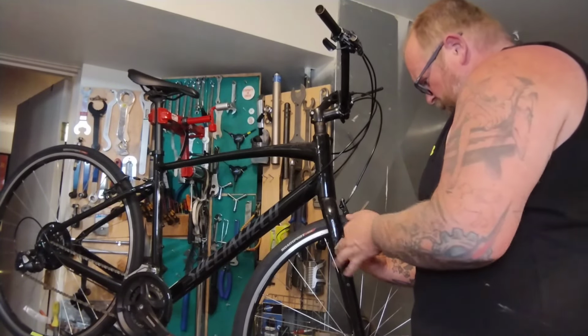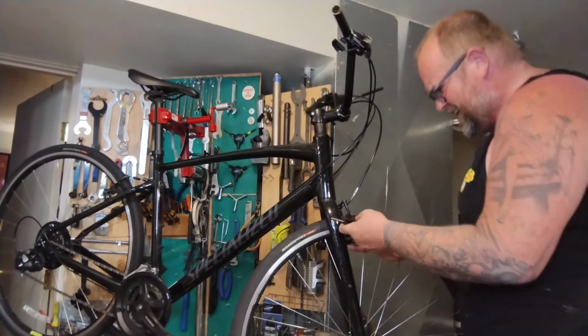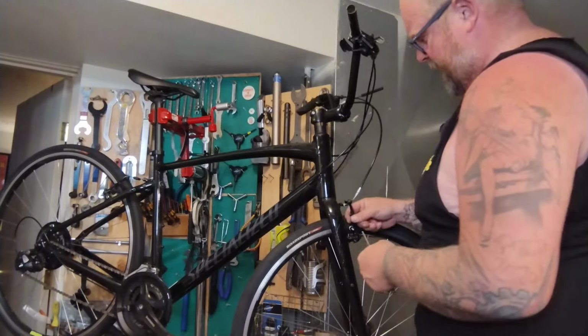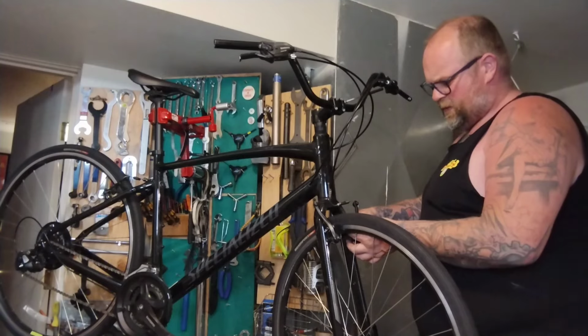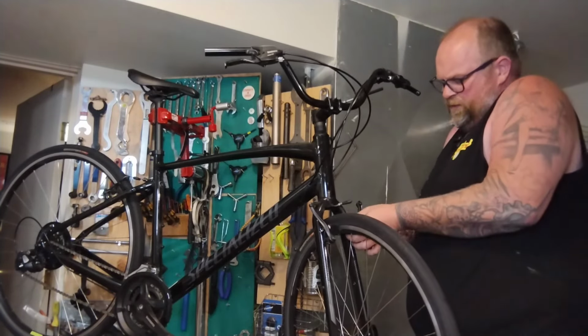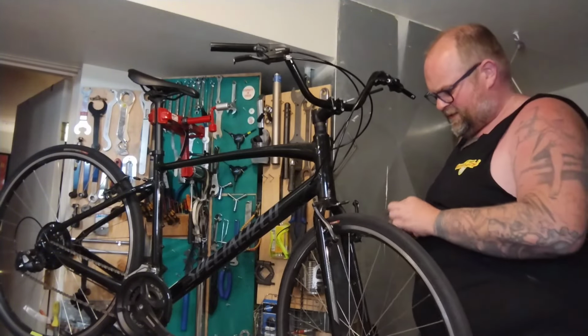Get them lined up on the rim where we want, and tighten. Then we can pop the spring back in place. Same thing to the other side. I bet these pads are set up terribly because these brakes have so much flex in play. They probably squealed like crazy, so they just adjusted the pads until the squeal went away.